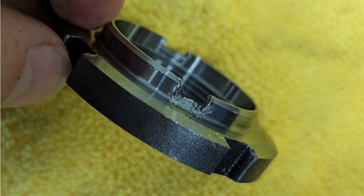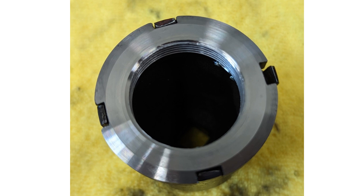If your transmission has the slotted nut, you'll need to bend back the tabs that lock it in place. This is actually quite difficult — you'll probably have to be fairly aggressive with a tool to bend these back, and it's probably the hardest part of the whole job. Once those tabs have been bent back or broken off, you'll likely need to make your own tool — most have made these from a 36 millimeter socket with pieces cut into it that slot into the grooves so you can remove the nut.